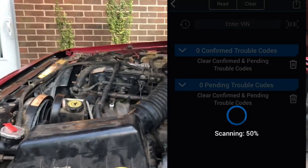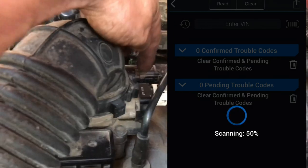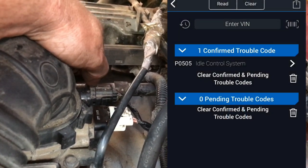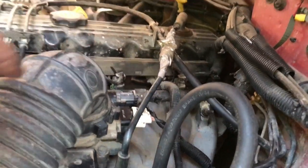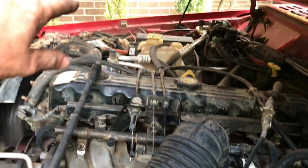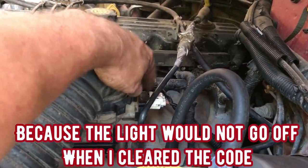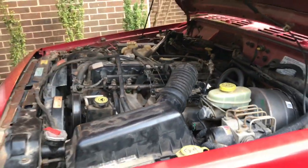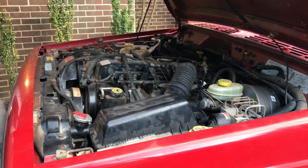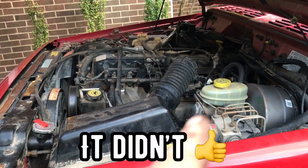After some troubleshooting, it was throwing an idle sensor code. I checked the sensors and the harness wasn't fully connected — I'd only loosely put it together. I reset the battery, reset the engine light, and now it idles exactly like it should. It sounds just like before, except without the manifold leak. The engine code shouldn't come back since it was obviously just the disconnected harness.